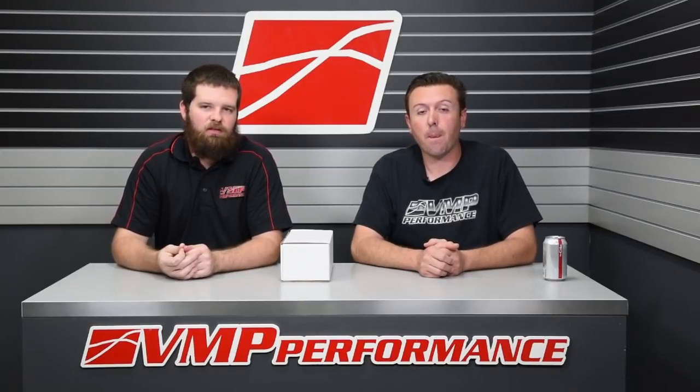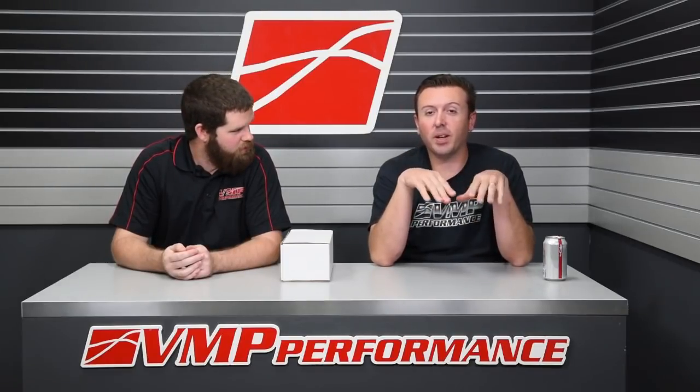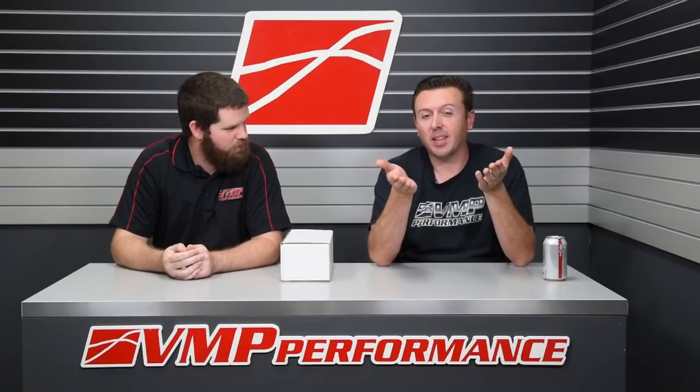You're good. Max wants to know, can I run a Ghost Cam tune on my setup, VMP Gen 3 16 GT? If yes, will it be available at some point at VMP? I don't plan on making a ghost cam tune for the blower setups. The overlap in the idle region creates a very undesired effect with positive displacement superchargers. The bypass valve doesn't open enough because of the reduced vacuum that results from increased overlap. And when the bypass valve isn't open, you generate an excessive amount of heat at idle, and it's bad for the supercharger, and it's bad for performance and everything.